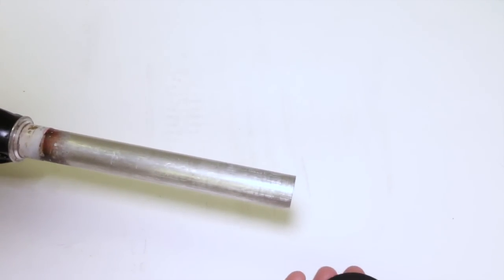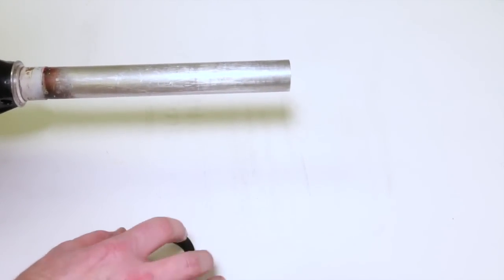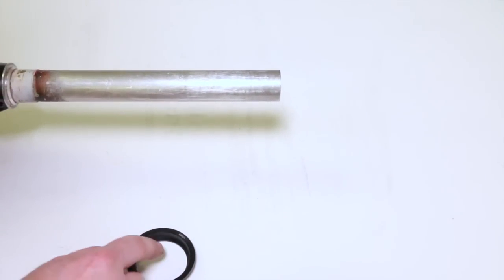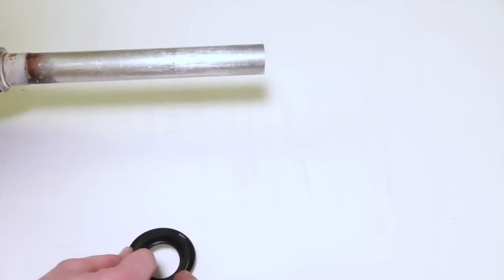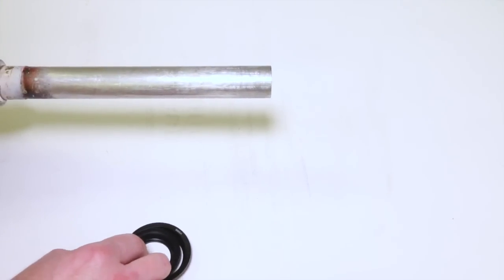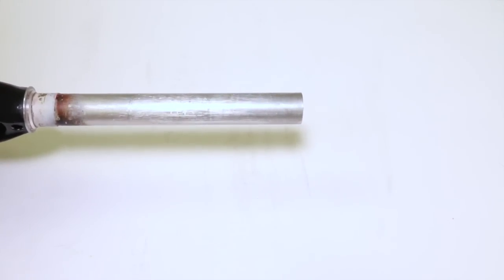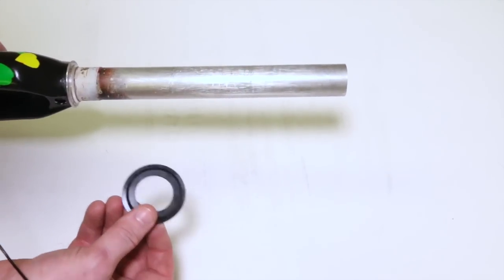They also have special cups if you have a semi-integrated internal frame where the base is filled in except for the little bit at the end. So it would basically be, turn it into that, and your bearing would be 1 1/8 inch lower. You can use your standard crown race that comes with that. That's one way. And this is probably the coolest way. I think it's the simplest way.